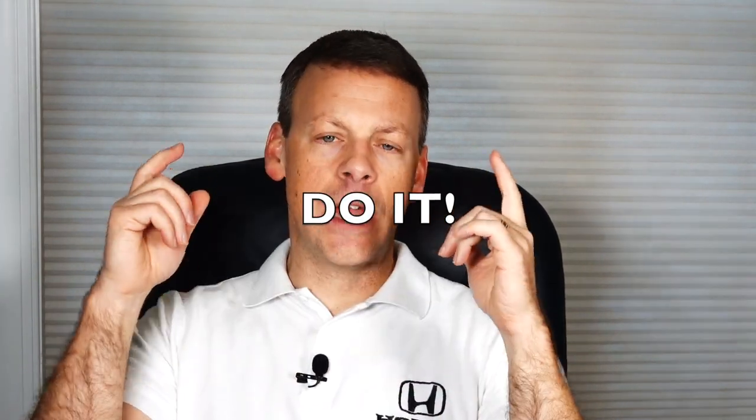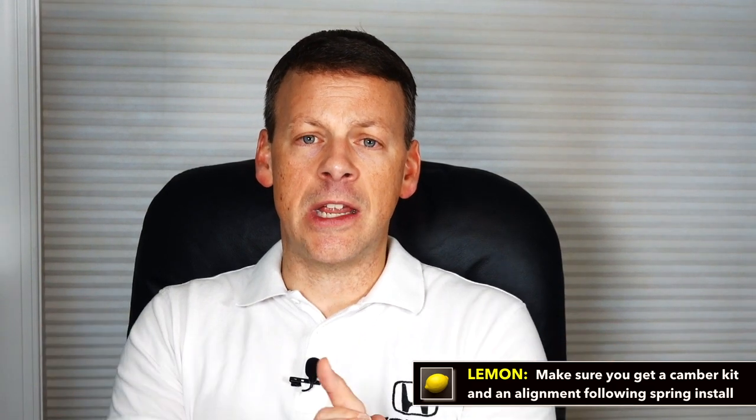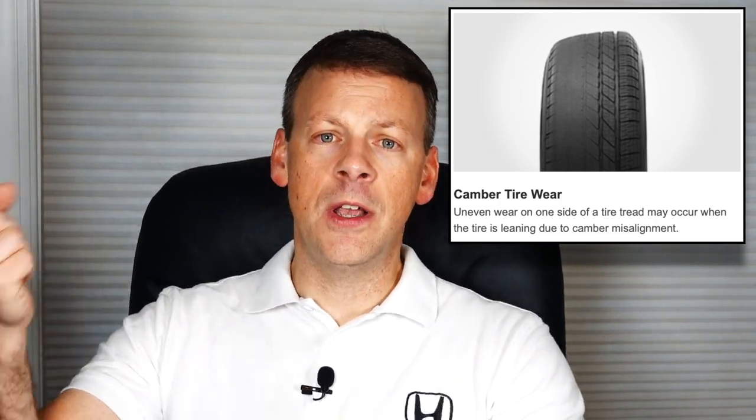And wait, I promise you, the two lemons, or the two potential lemons, when it comes to buying springs for your 2018 plus Honda Accord. One is, no matter what spring you get or how much of a drop, it is highly, highly, highly recommended that you buy a rear camber kit, because as you drop that car, it's going to put your camber out of spec, and it's going to prematurely wear your tires unevenly. So you definitely don't want to have that. So as you're considering the cost of the springs, please consider the cost of a camber kit. Make sure you take that into consideration.